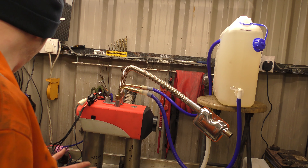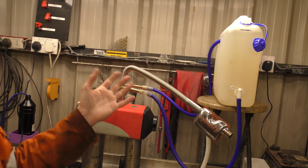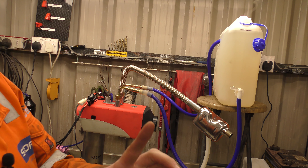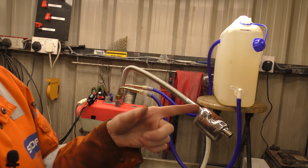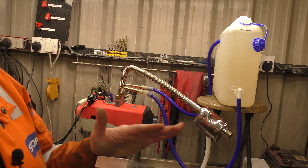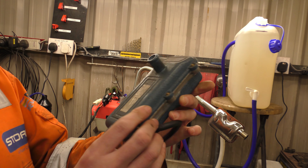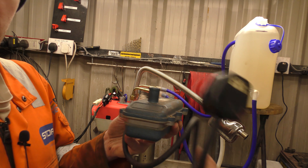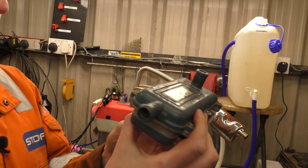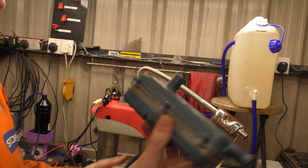There's wiring on the desk — I'll show you how to wire it up and get it working, hopefully. Also, my finger blast grannies suggested an electric water preheater out of BMW, so I found one of them. I have a feeling it's going to be like glow plugs in a box by the looks of it — a really high current, 12 volt heating device. But we'll get to see that. I found this in my stash the other day, so I thought we could plumb this in. This is an electric mains-powered engine preheater. This is a three kilowatt version — the pump and the heating elements all built in. So we can try that out and plug it in and see how long it takes to heat up 10 litres of water at three kilowatts.